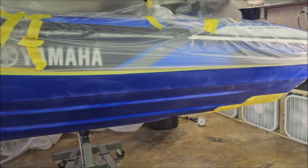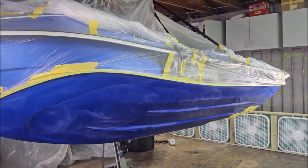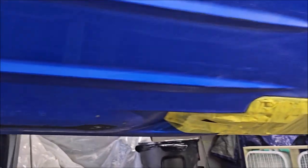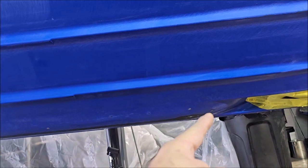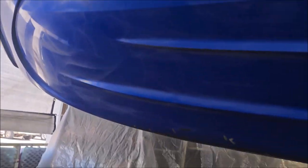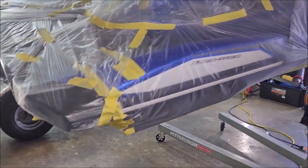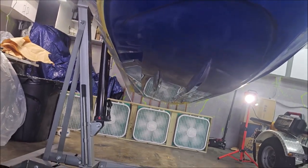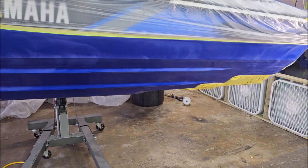I'm going to go ahead and finish this thing up with the prep and I'll bring you back before I start shooting. All right, party people, she's ready to be sprayed. I got the compressor pressurized and it's ready to go, just got to load my gun and start shooting. I've got the intake grate all taped up back here. I've got those gouges really clean and nothing is chipping. I used my nylon brush to scuff it all up, wiped it down with my prep solution twice — once before taping after I sanded, and once after taping — and now it's time to get this thing lined. I'll bring you back in a few minutes. We're going to put an extra heavy coat on.